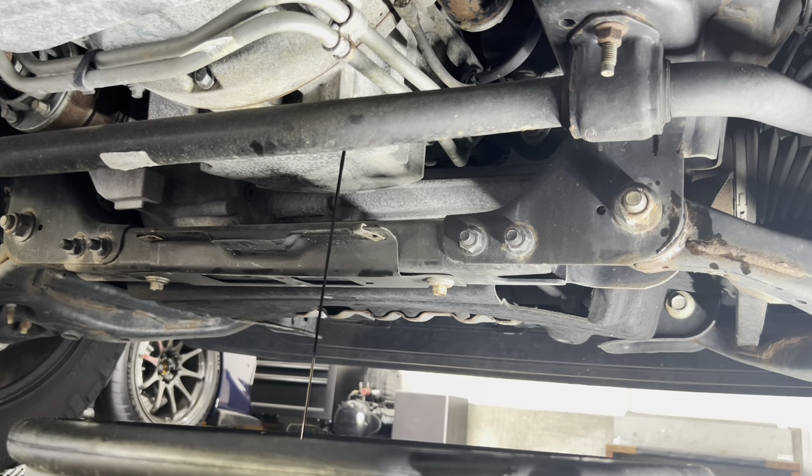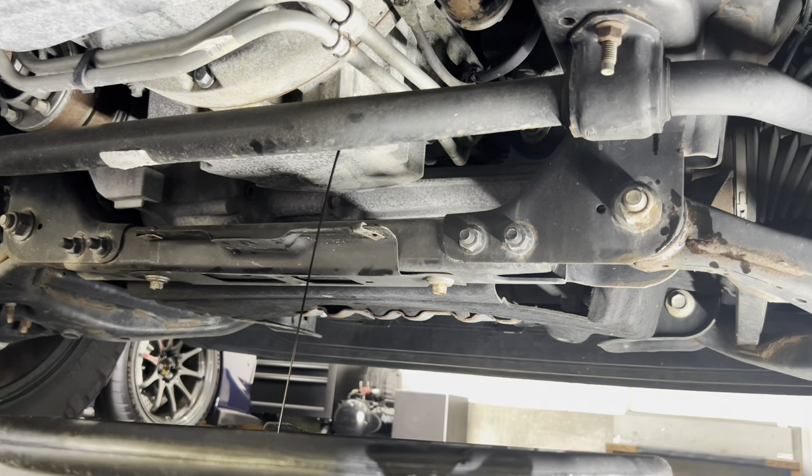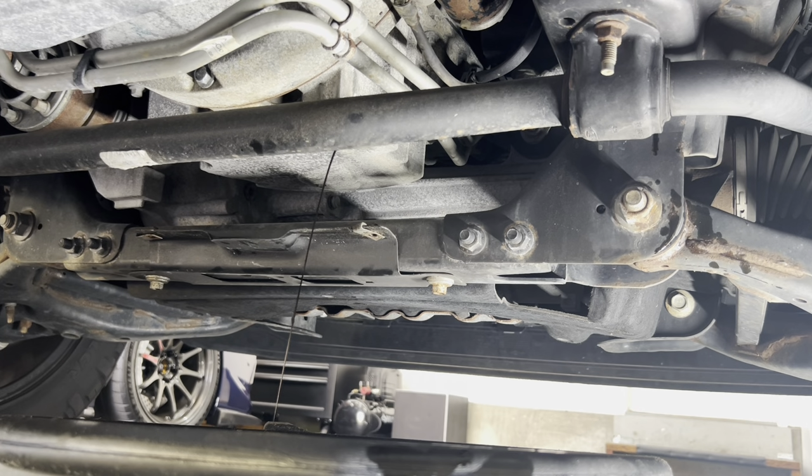All right, so we got the oil starting to drain. Gonna let it sit here for 10, 15 minutes or so, let everything get out as much as possible. Wasn't too bad, it got on my hand a little bit, but we were able to not make a mess. We got it into the bucket, so we are good. So I'm gonna let this drain, then once this starts dripping, we'll put the plug back in, and then we can go ahead and do the oil filter.